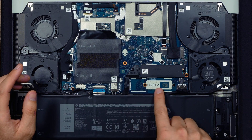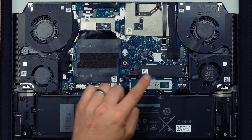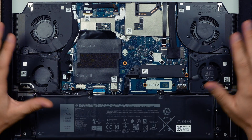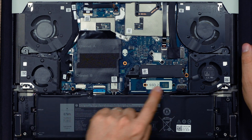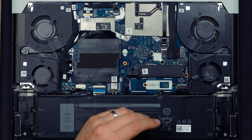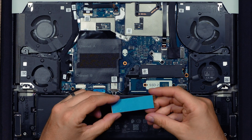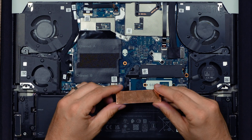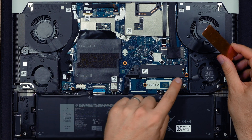If you've got a decent SSD in your primary slot, you can save yourself hassle by just buying a larger second SSD. But today we're going to clone our primary drive, which is a quick and easy way to do this. The first issue: Dell does provide the screw for the second SSD slot but does not provide a heat plate. I've got a very cheap heat plate from Amazon — link in the description. I've already tested this on our channel and it dropped temperatures by about 10 degrees on Gen4 drives.